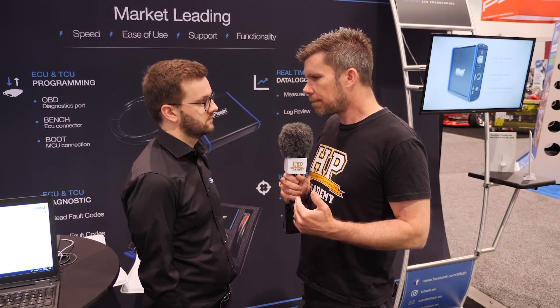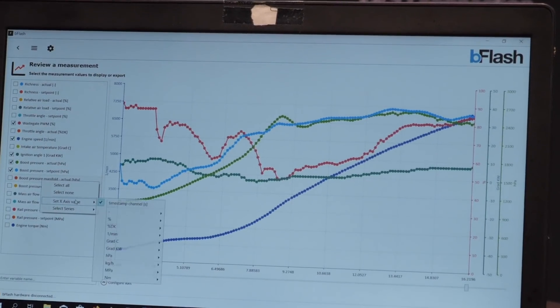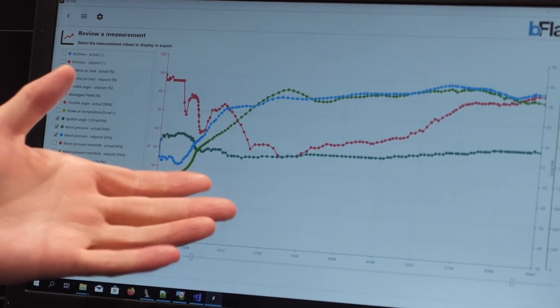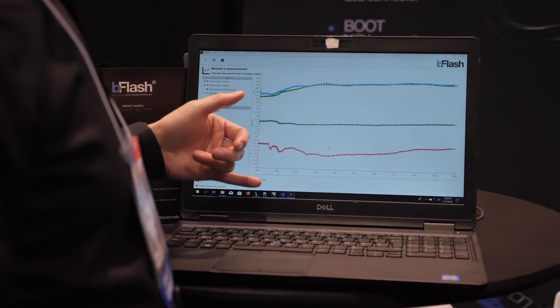Around 600 maps is more than enough for most mainstream tuning — raising boost pressure, changing ignition timing, or adjusting lambda is perfectly fine with that. However, once you try something like converting an Audi R8 or Lamborghini Huracán to a twin-turbocharger setup, you'll need more, because you'll need to tweak sensors and install new sensors that can read positive boost pressure the factory setup can't handle. All those parameters need to be changed in the ECU, and a standard definition won't cover them.